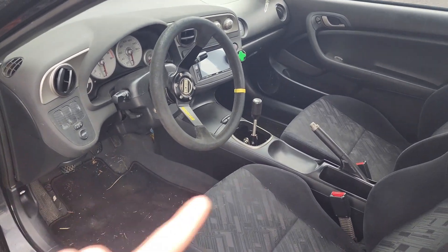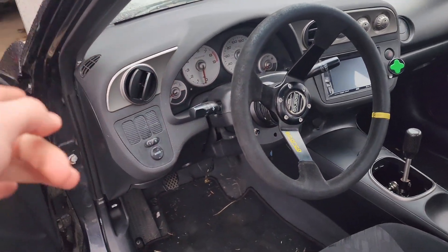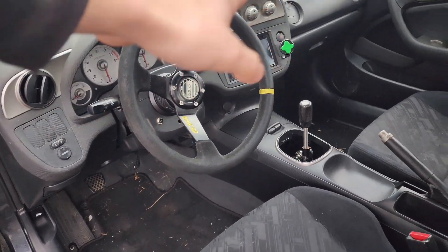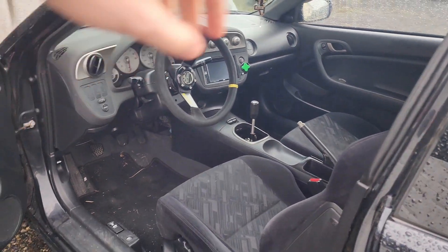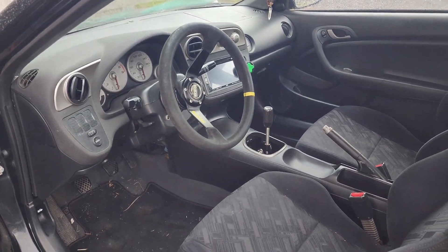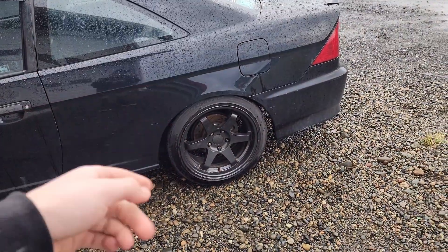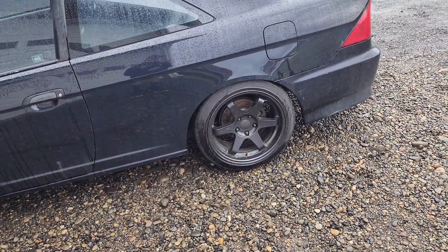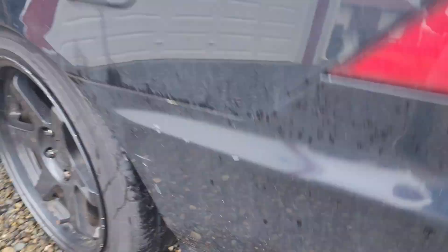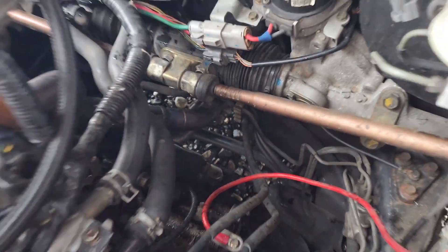There's the RSX dash. Since my last video I've really updated the interior — cleaned up a lot, added an Acuity short shifter, and now have the RSX Type S cluster. I also redid some of the heater wiring so I got more functions working. I drive it a lot still. Since it was a base LX, it didn't come with a rear sway bar, so I had to modify and insert my own rear sway bar from an RSX with Truhart rear suspension. In the front I'm running a Honda Element front sway bar to help clear my header.